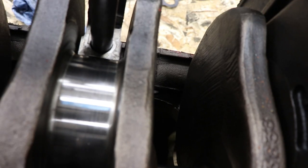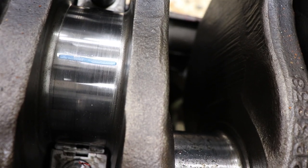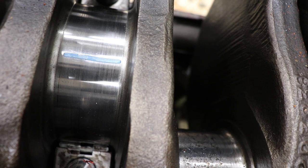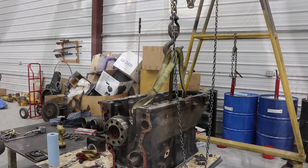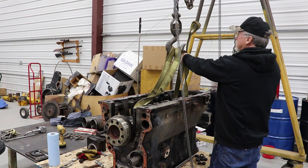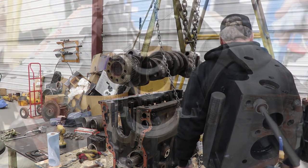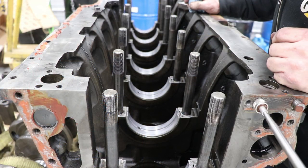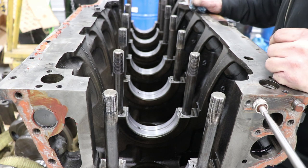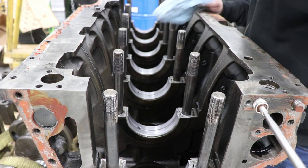Using their little paper measuring deal, that looks like about nine thousandths clearance in there. I'm gonna take the crank out. The bearings are just worn really bad — the crankshaft isn't. Crankshaft's in good shape. So I don't know what to make of it.